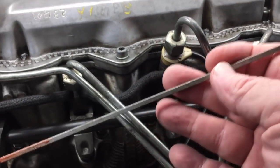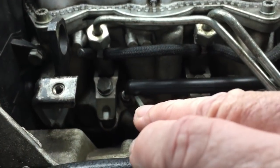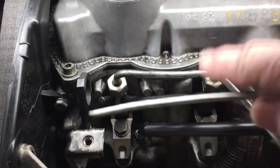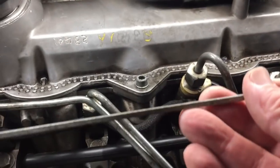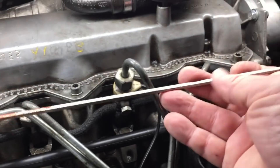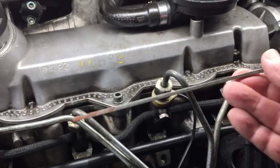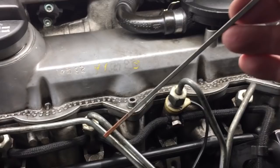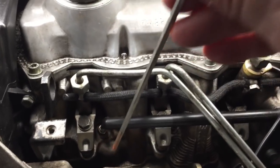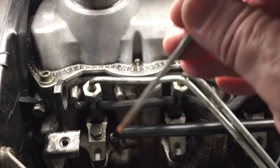In order to get TDC mechanically and exact, what I did was remove this glow plug right here — took the glow plug out, pulled the cap away — now you've got a hole. You can't just stick anything down there; you have to be careful. I've got this square rod, which is a one-eighth inch rod, like a key-way type rod. You can buy these at stores like Lowe's or Home Depot in the steel projects area, or at a machine shop.